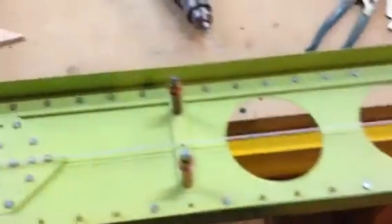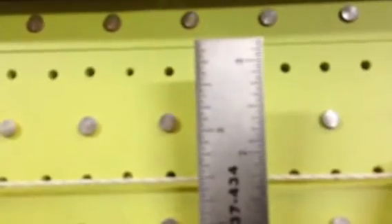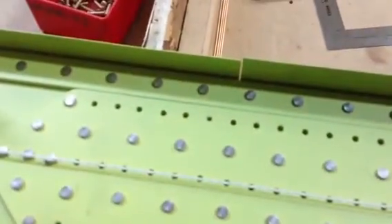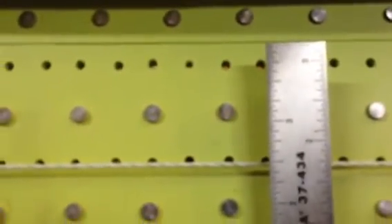Now, I'd heard this before and I thought, well, how much could it really move the spar? Well, it does. So let's have a look with my little zona square sitting up against the flange of the bottom of the spar. You can see that string's coming through right there — right through at two and a half. While I was riveting away on the spar, things just started looking goofy to me, so I threw my string on there and checked it, and I was actually a sixteenth of an inch out — a sixteenth short of being true at the center. The spar started to develop a crescent shape, bowing towards the bottom.